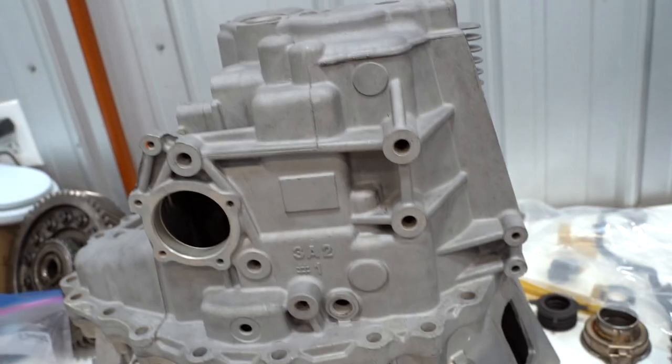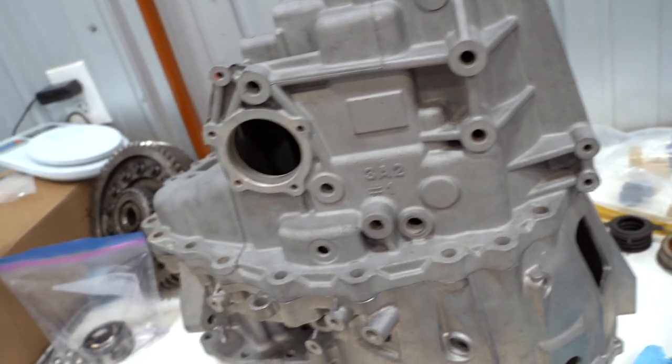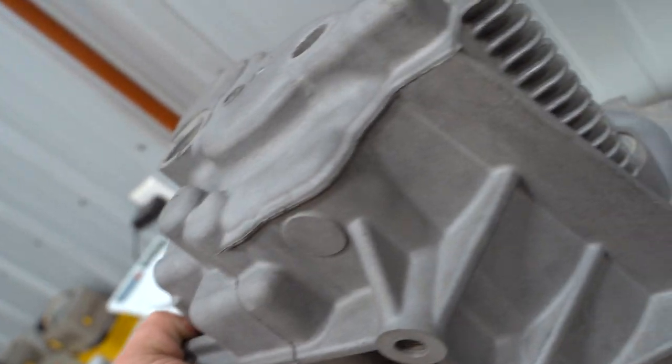I'm about 98% sure that this is exactly what we're after. I'm just worried it might change during the curing process. But nonetheless, let's move on to the transmission case. We gotta get it cleaned with the brake cleaner, let that evaporate, throw it in the sandblaster, re-blast it. Provided that this test piece is a proper color, we can then Cerakote the trans. After this thing is Cerakoted, we're gonna have to go through and really take some time and get all that sand out of it.